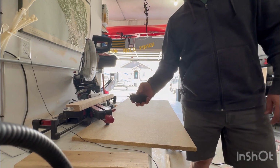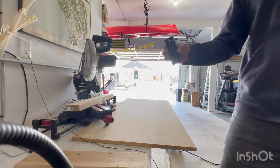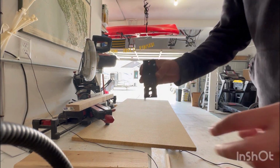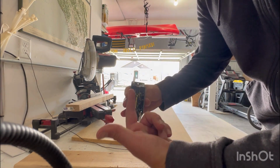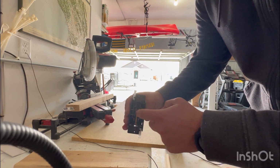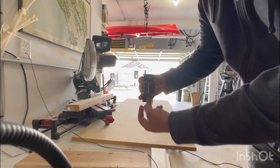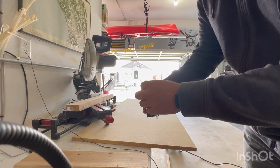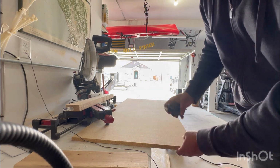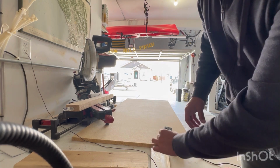So one of the other things I had to consider when it came down to taking out that angled wall and putting it in this cubby was positioning of this outlet. The way that this one hooks up, you push both wires in. Black's over here, white's over here, ground's in the middle. Wires stick out the bottom. The screws up here don't actually screw in. What it is, this little white tab bites the back of whatever you inset this into.